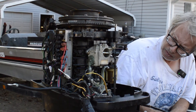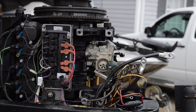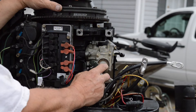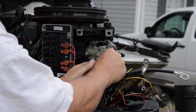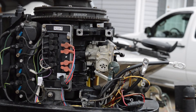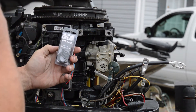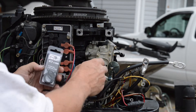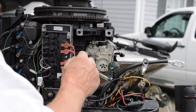All right, there we go — and we got some leaks. These old carburetors with the fuel pump on the side: they have this plastic piece, there's a screen underneath, and generally these old gaskets just don't seal well at all.